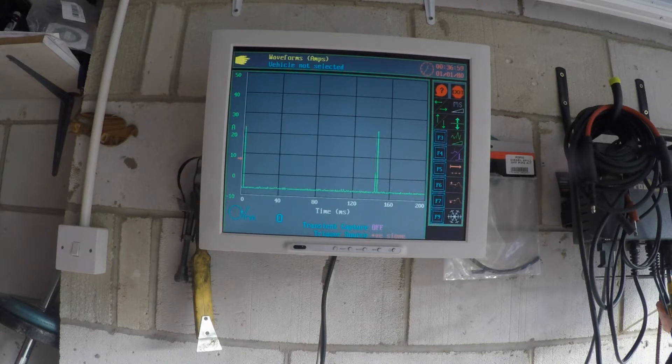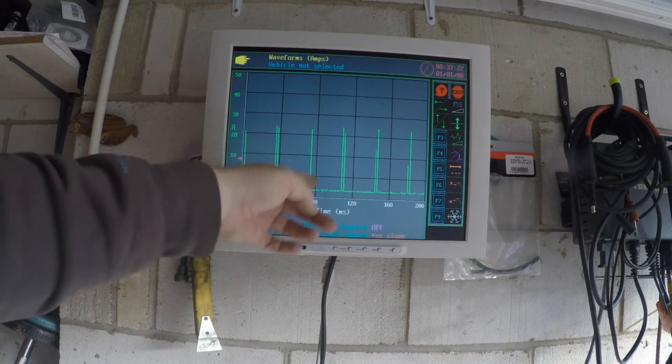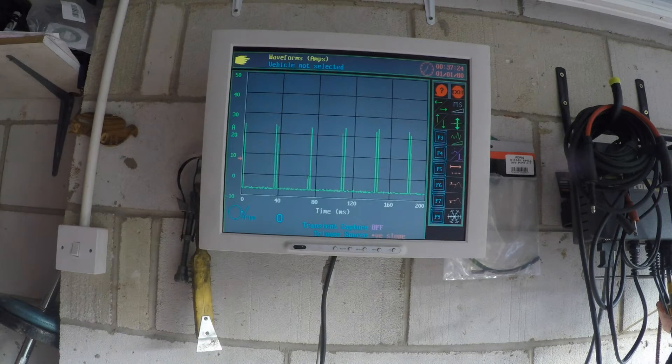If I attach the four wires, I'll go and do that and you'll see other pulses appear because this is a four cylinder job. Just keep your eyes on the screen as we go into the four of them. That's all four now connected and you can see - say that was cylinder one, three, four, two, one, three and the rest off the screen. But if you increase the time base too much you get what's called aliasing - just too much information and it kind of jumps.